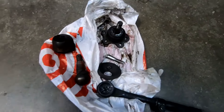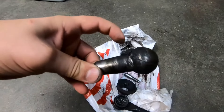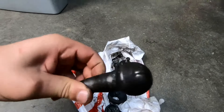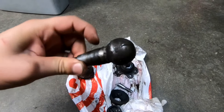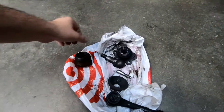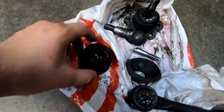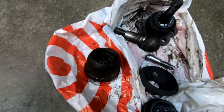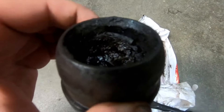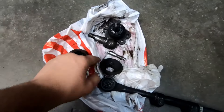The big problem is this ball joint. If you look at it, that's just grease — there's really no defects on it. These little lines are veins that grease it, so that's no defect. But if you look inside, there's a noticeable gouge out of it and it's actually cracked. If you look closely, all of that right there is an inner sleeve, and that's a piece of it right here as well.